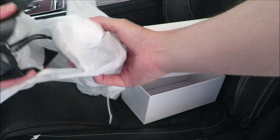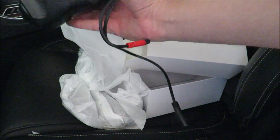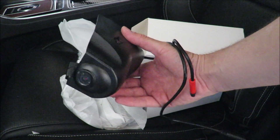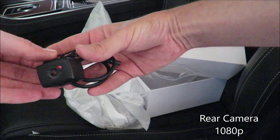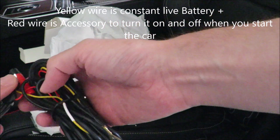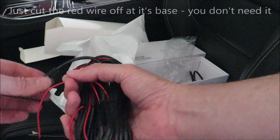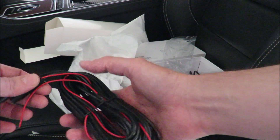Let's see what we've got here. It's quite heavy — actually it's the cables that are heavy. This is identical to the portion that goes on my car, and I'm going to show you guys later how I take the old one off and put this in its place. This is a really nice camera for the rear — just going to stick some double-sided tape on there and stick it to the window, then use those screws to tighten it and get your view right. This is the actual power cable with the little fuses attached. This is the cable that's going to run to the rear of the car. The red wire — like I said in my previous video on my Mazda — you don't need this red wire if you're not going to hook this up to a backup camera. We're not going to bother with that.